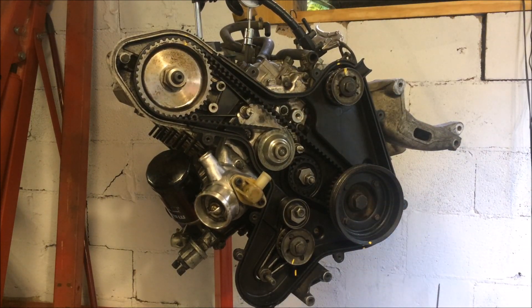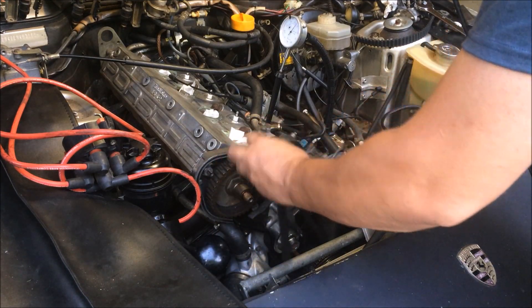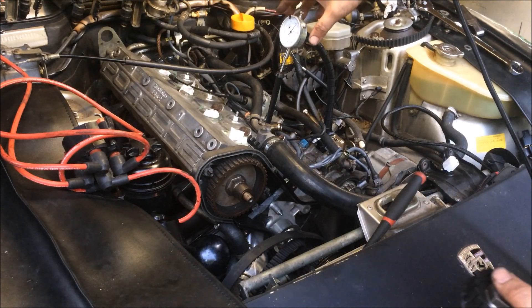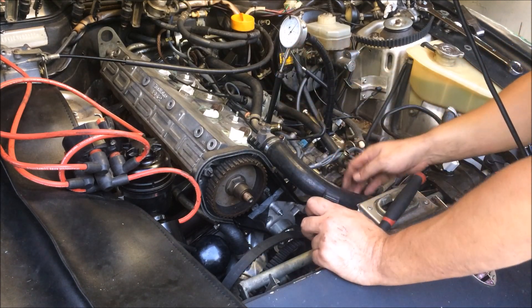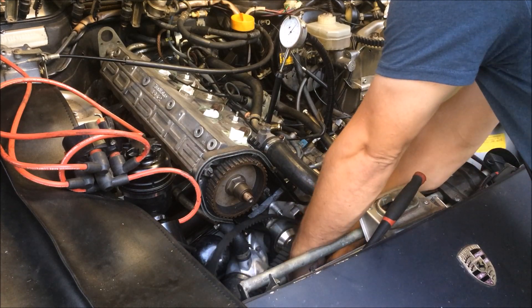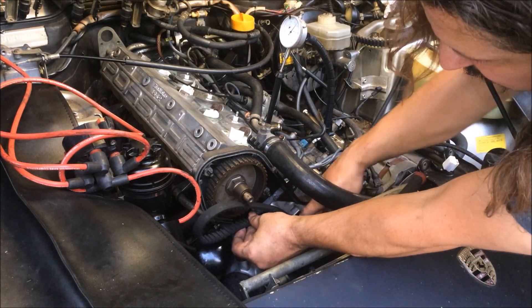Now I've got an engine over here that I actually need to put the timing belt on, so come with me as I do that. Now I need to change the belt on this engine in the car, and now that you've seen it on the stand you should have a better idea of how everything is going to go together. I have my belt here and I've already got it around the crank sprocket down there. I have my flywheel at top dead center and my dial indicator here is confirming that. So the first thing I'm going to do is put my tensioner on — make sure that you have the one that has the flange at the rear, and also make sure that your boss is protruding from the back of the belt cover. Now that I have the tensioner on I'm going to run it along the water pump here.